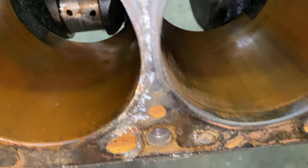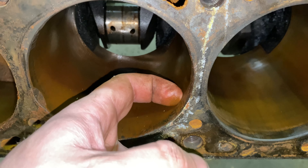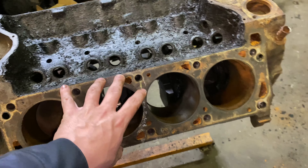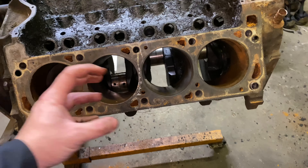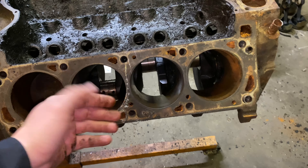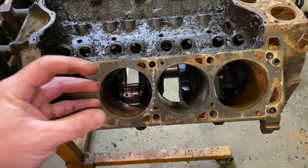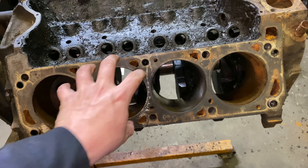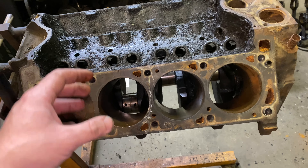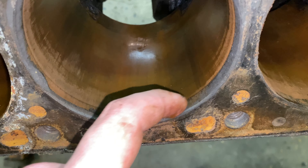So here are the cylinder walls. These cylinder walls are really, really clean. Your fingernail doesn't even really grip it. And that's how you tell if your motor has a lot of wear on it — a motor with a lot of wear will always have a ridge right here your fingernail can catch on. That's from where the rings go up and down in the cylinder. It always stops at a certain point, it never wears all the way to the edge. So you'll have a ridge from where the rings have worn, basically a groove. But it'll be a whole cylinder from here down, so it has a wear pattern and a ridge in there. This has no ridge — fingernail doesn't get caught. It's got just a little bit of carbon buildup right here, which is common, but the fingernail doesn't really get caught.